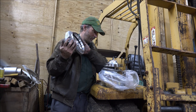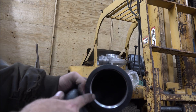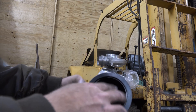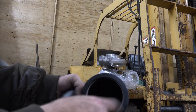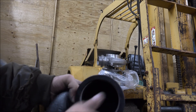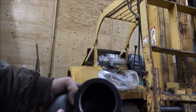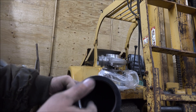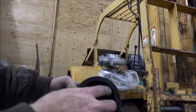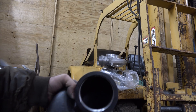The other night — I didn't film it — I did the same thing to this exhaust housing piece. I set it up on the mill and cut out the inside so that there's a pilot. So now when this goes onto the back of the turbocharger, it'll have a flange in there to help keep it centered without just relying on the V-band. That'll also help keep it from leaking because instead of sealing flat against the face, the exhaust will be entering back in there and it would have to come back around to escape. So once this gets a little soot in there, it'll pack in tight and should never leak.